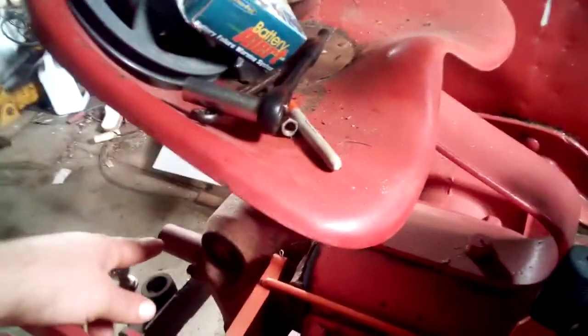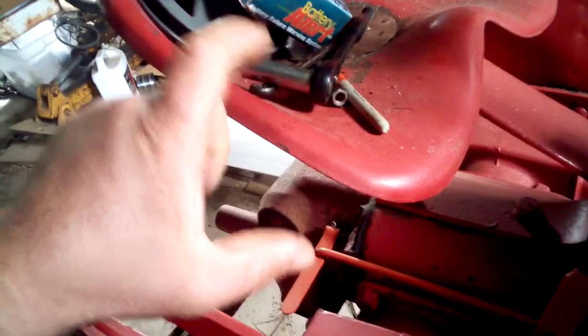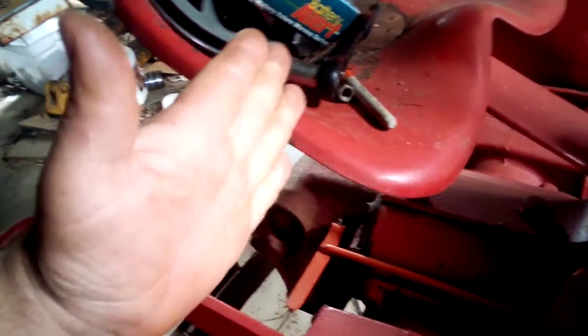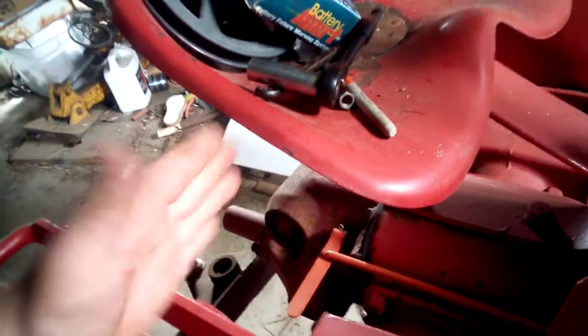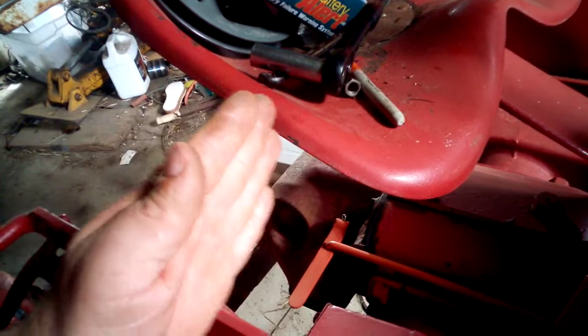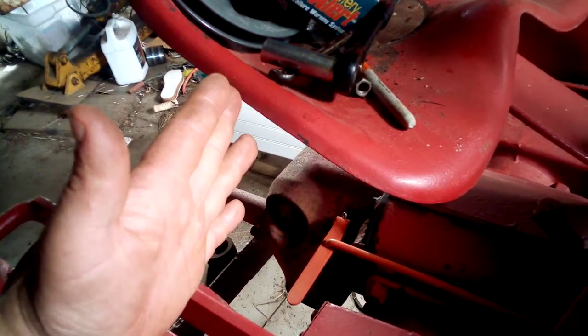When I bought this PTO, it was said ready to install. Well, there's supposed to be a clip that keeps the bearing in position. Well, the clip was broke. So when I got the thing, there's pieces of the clip and everything all in there, and you could see that every time it was engaged or the gear moved, it was literally grinding further and further into the casting.